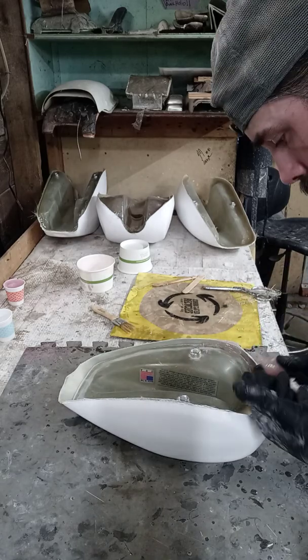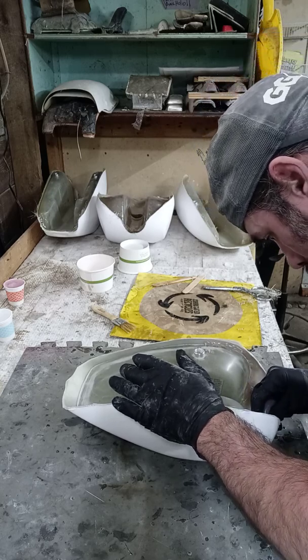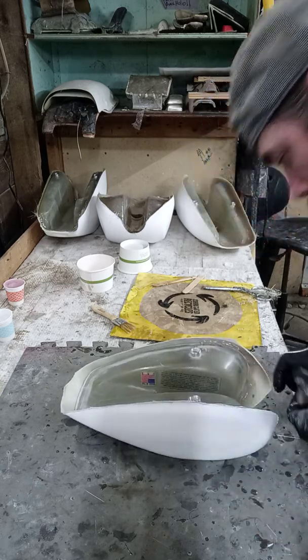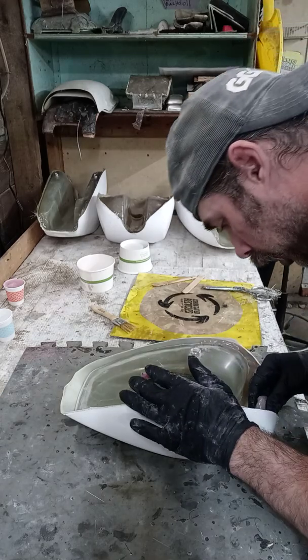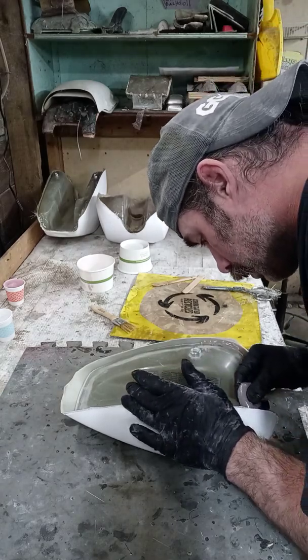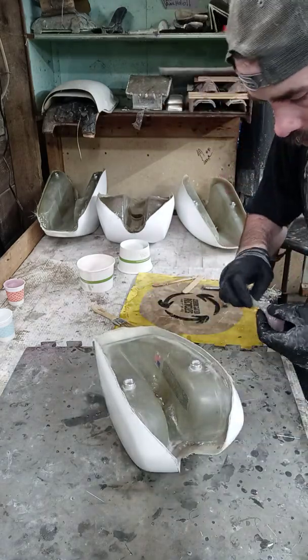So we goop up these radiuses first, and a lot of people just throw a laminate in there — a very, very wet laminate at that. I like to actually basically caulk the seams. So we might damn near get all of them here.